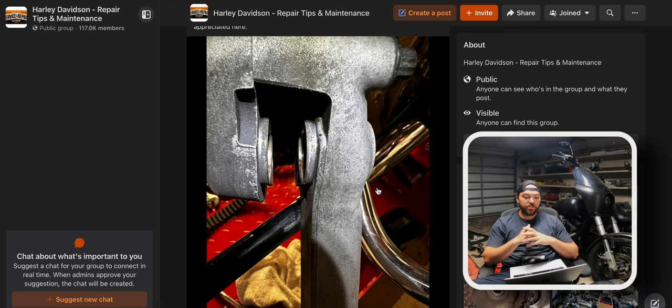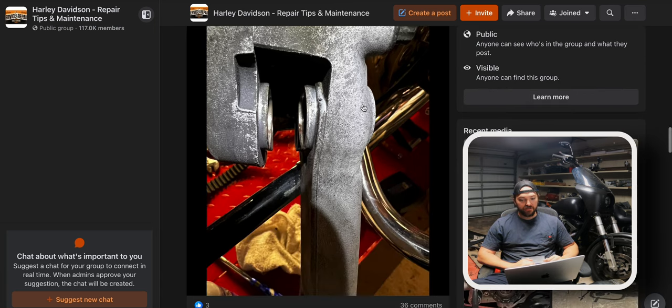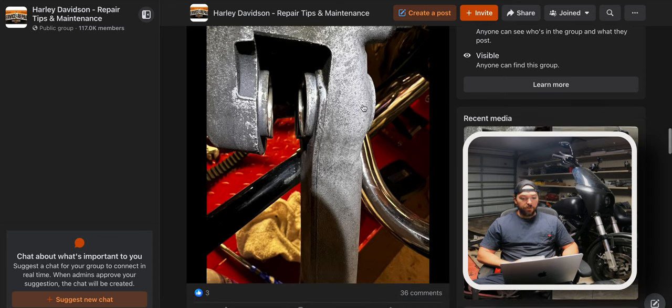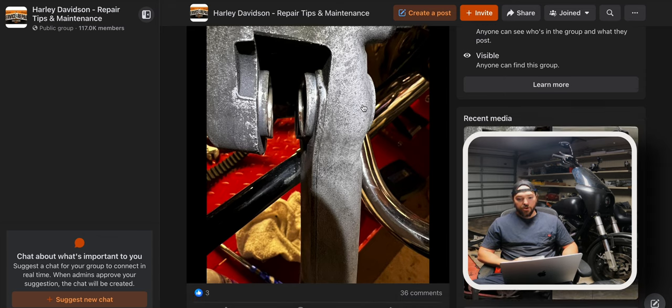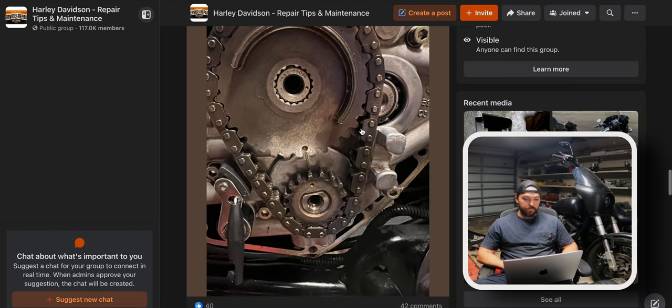I have encountered some stuck pistons on calipers before, but according to this guy I don't think they're stuck — I think you just can't get them in far enough. So what I would do is pump the brakes out a little bit, clean around it. You can use a little emery cloth, just be careful on the boots. Then use the old brake pads to push it back in and try to fit the new ones in. They can be kind of a pain.